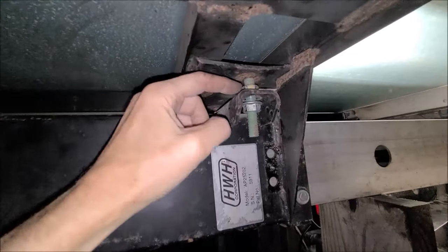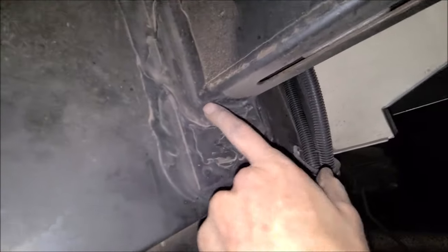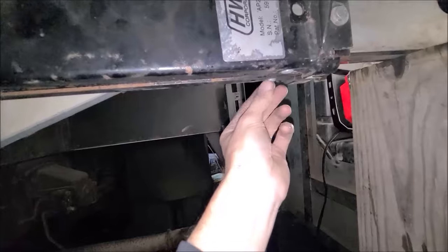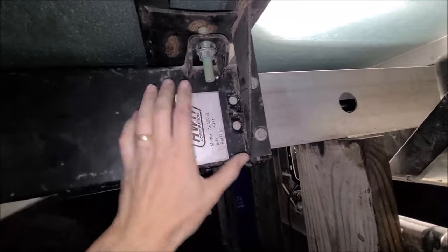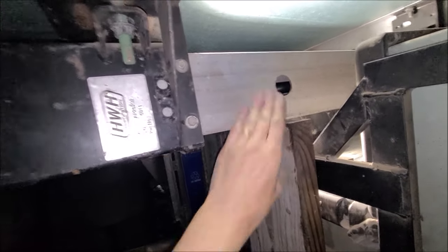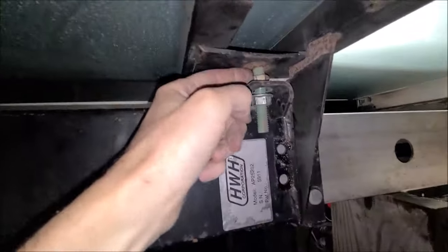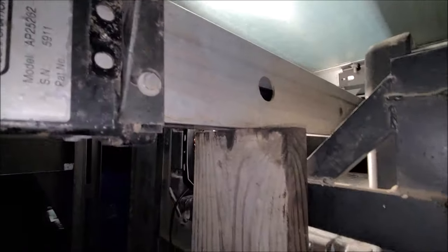So what I started doing, because these nuts were all the way up, this piece of metal here was almost to the top. And you see, well, it's not done it now. When I first started here, you can see the rubber was torn away where it was cocked up like this. So I'm trying to bring it back to the factory position. And by doing so, I'm starting to get some movement now. So if you run this, you're having problems with it. You gotta loosen up this gusset. There's two screws on each side. And I'm pushing this down. By pushing this down, I'm pushing this down at the same time this board, this jack, is preventing this from moving. And so by pushing it down, I'm creating a gap so I can hopefully get these little bearings out. So I'm gonna continue working on these bolts. Hopefully I'll get enough clearance. You can even see this metal here is bent. Some other pieces have been bent under here. It's had a rough life.